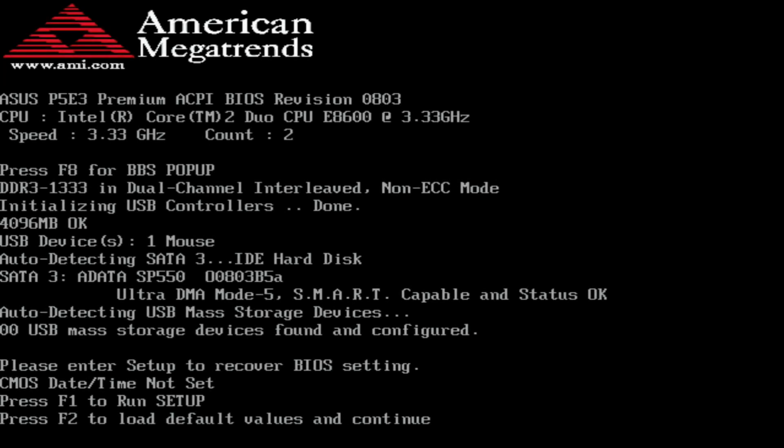Okay, in this video I thought about showing you how I actually bin these X48 LGA775 motherboards. When it comes to serious 775 overclocking, you do have to bin these motherboards because they vary a lot in performance and in overclocking capability, because the north bridge of the motherboard is almost like a second CPU by today's standards. The memory controller resides inside the north bridge, and the north bridge also determines how high a frontside bus speed you can eventually reach, therefore affecting the maximum possible CPU overclock as well.